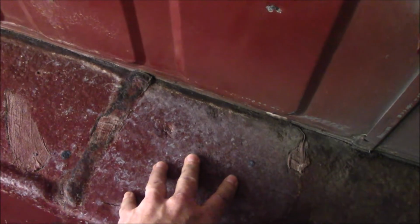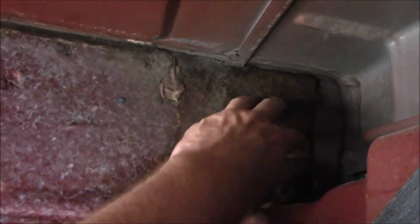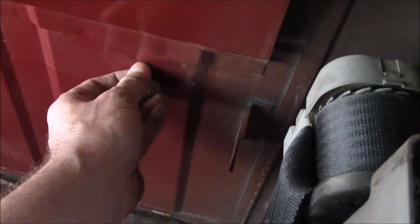I had some dampness back here, and you see the signs of it. But there's the factory sound deadening that goes right here. Oddly enough, that's the only place I see that they actually put it. As you can see down here in the cab corner, there was some wetness there too. I'm not sure where that's coming from, but I got penetrations all over in the back that I'll be sealing up. Mainly with the sound deadener. The actual butyl will cover that stuff up, seal it up, and it'll be good to go.